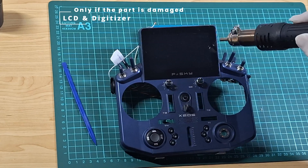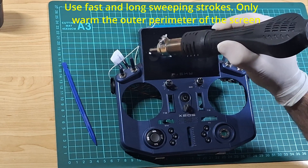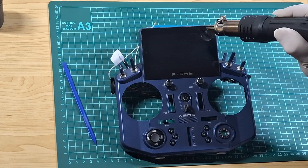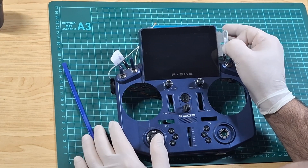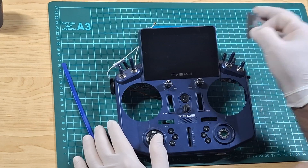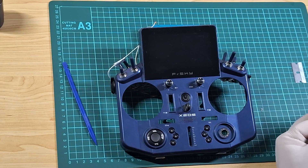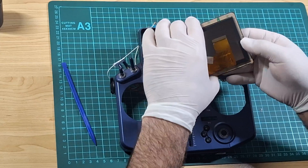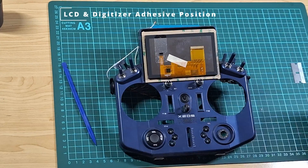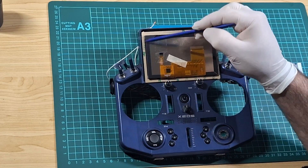Next is the LCD and digitizer — it's not recommended you do this. If the part is damaged and needs to come off, set your heat gun to 150 Celsius maximum. With fast, long and sweeping strokes, only warm the perimeter of the screen, making sure not to spend too long in one spot and create heat spots, because you will damage your LCD. Once you've generated sufficient heat around the screen, gently coax the screen off either with a suction cup or with a razor blade — you will be repeating the heating and coaxing until the screen comes off. Do not do this unless this part is damaged. If you're simply shell swapping, buy a new LCD and save yourself the pain.